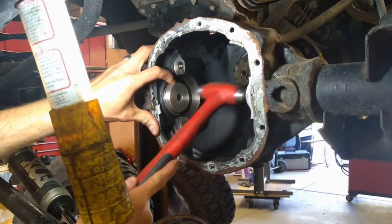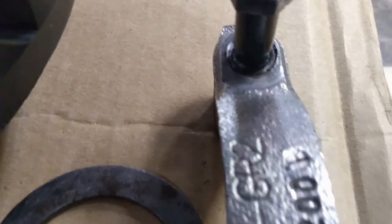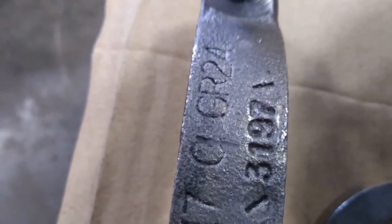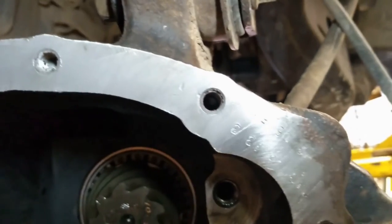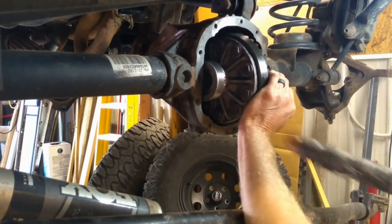This is a good time to install my axle seals, otherwise I would most likely forget to install them. You can install them with a socket, but it makes for a pretty short throw. I grabbed my race installing tool so I can get a better swing with my hammer. On these bearing caps you can see where I have my marks — there are my two dots at the top, and I can also see a sideways line next to the 3197 stamping that appeared to be somebody else's previous mark. When I put this thing together I know I'll have it in the proper spot.